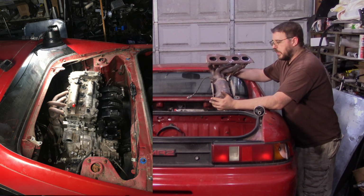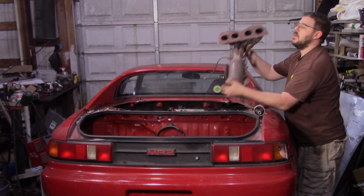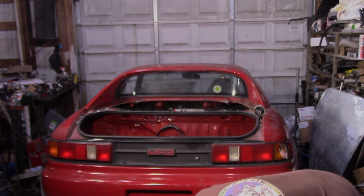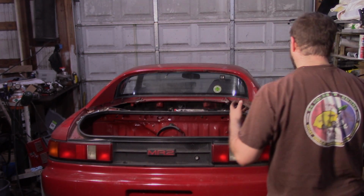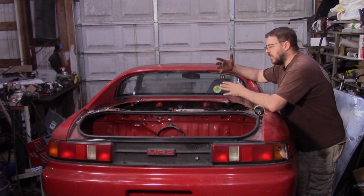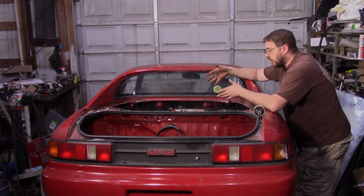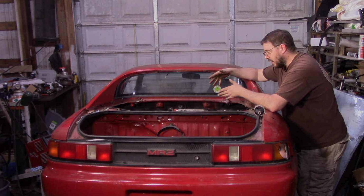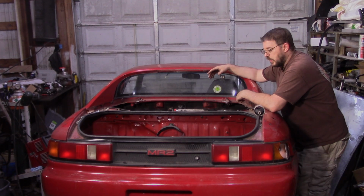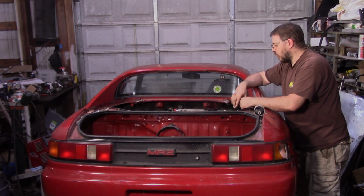It just fits beautifully. So for you guys out in California looking for a modern motor, now of course you'll have to run this. You'll have to run the stock airbox. So you're not going to get the 205 horsepower to the ground. But effectively what you'll get is something very similar to what the MR2 got in turbo trim. So something rated to about 200 horsepower to the crank, maybe even a little bit more. So the feel with one of these, which should be able to be made emissions legal rather easily, is going to be effectively something like the Beams upgrade, which plenty of people have done and have really enjoyed, except Toyota's made about 4 million of these, so they're much more available.